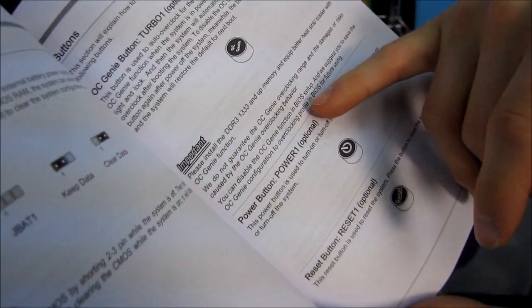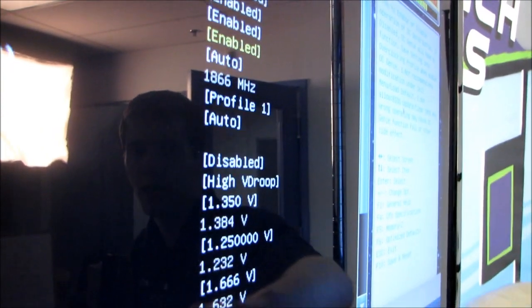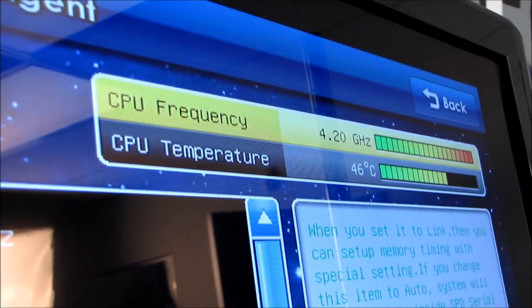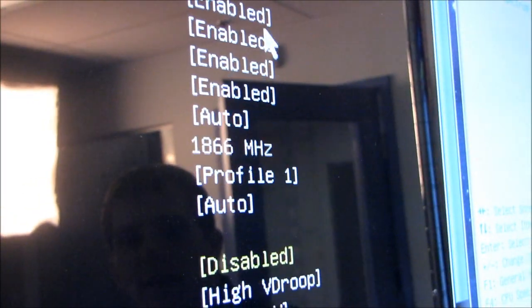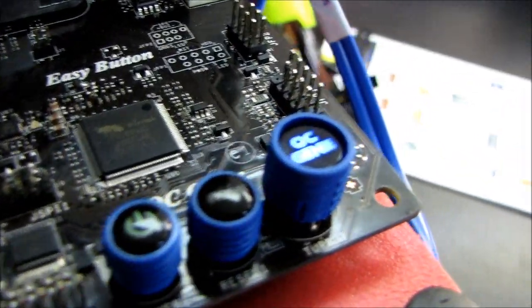We're trying to figure out what's going on here. It says you can disable the OC Genie function in the BIOS setup, which I haven't done. In the BIOS, what it's telling me is that we are overclocked right now, including the RAM — it's loaded an XMP profile all on its own, it's increased the CPU voltage, it's increased the RAM voltage, and in theory we're running at 4.2 GHz of adjusted CPU frequency. Let's set OC Genie to enable just in case that makes a difference. We're going to save our BIOS profile and then reset — OC Genie is working now and we're going to boot up in just a moment. That was me actually using a manual — you'll probably never see this on Tech Tips again.